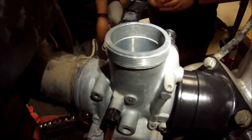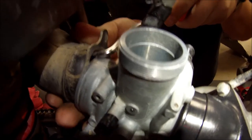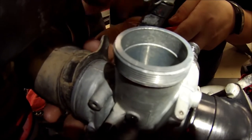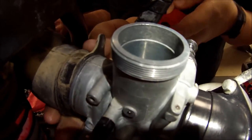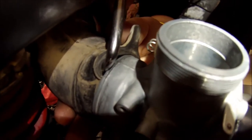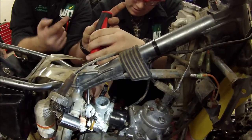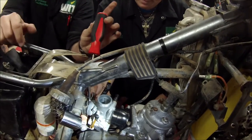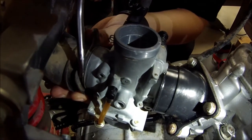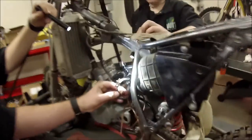I'll pull that back off and let Leah do it. The boot is fragile — if you don't lube it, the chances of poking through are really high. Go all the way around the bottom, just let it fall into place on its own. Go around the top, keep going, don't stop. If you're tipped really far forward, the tool wants to punch through the rubber — keep the tip down so it's not going to hit.